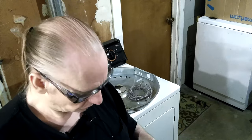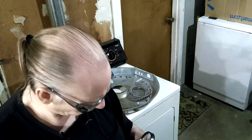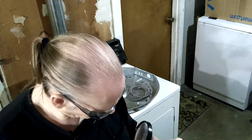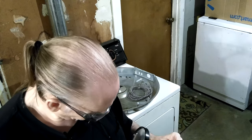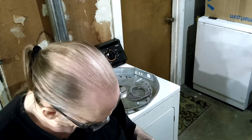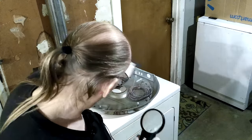I ended up getting it — the Amazon seller didn't say Napco on anything, so hopefully it'll be good. Says made in the USA, which is cool, and doesn't say 'made in USA with Chinese parts.' According to the instructions: divide the heater coil in half, place the center support insulator in position at six o'clock center. Then divide the heater coil in quarters with the coil support insulators at three o'clock and nine o'clock, placing running coil insulators around the whole thing — should be 15 total insulators equally spaced.